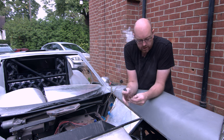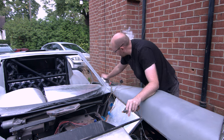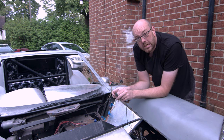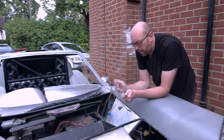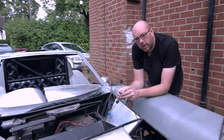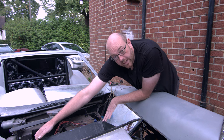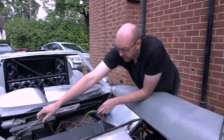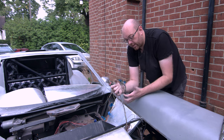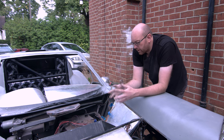For the headlights, we've run one set down this side along here — it goes around through under the arch and into the back of the headlight on this side. The other wire is the indicator bulb, and this one is the horn. I haven't worked out what to do for the side repeaters yet — whether to mount something into the wing mirror like on more modern cars or put something in that panel on the side behind the wheel. Let us know in the comments. The wiring runs across the back of the bonnet vent to the other side, and the plugs are all already spliced on, so the routing portion of the front wiring loom is done.